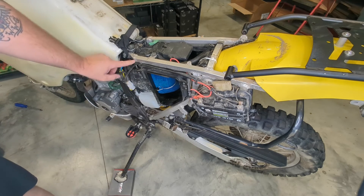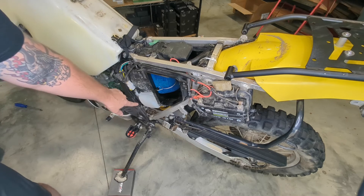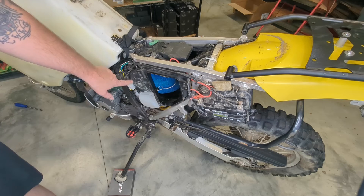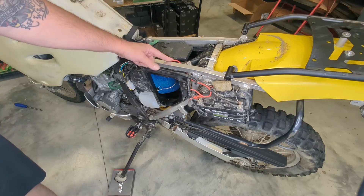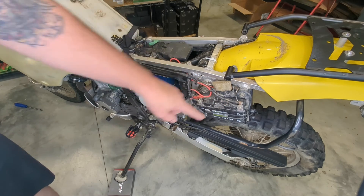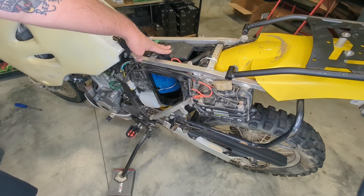Here we are on the left side of the bike. The stator connector runs right here — we have it coming up from the stator and plugged directly into our harness with a mating connector. Then running up along the frame, the battery connections come out of the harness and go straight over directly to the battery terminals. This setup lets you bypass all the vehicle's wiring and makes for a really nice upgrade on the DRZ400.